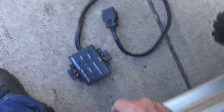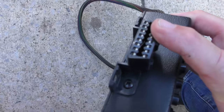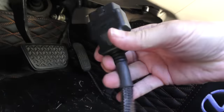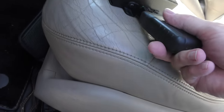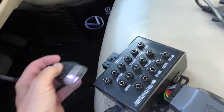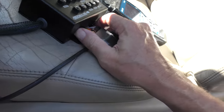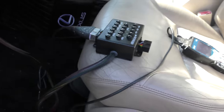So it has to be checked out correctly using what's called a breakout box. This plugs into the OBD port and has a plug on each end. To diagnose a problem correctly when a dongle is already plugged in, you plug this into the OBD port, then connect the customer's dongle to one end and your scan tool to the other end. The customer's dongle is connected to the system, so is mine, and I can analyze the problems. If I disconnect the customer's dongle and the problem goes away, you know the dongle is creating the problem — and they often will.